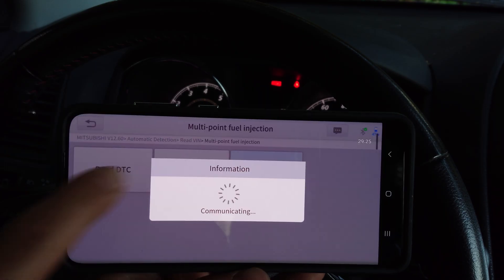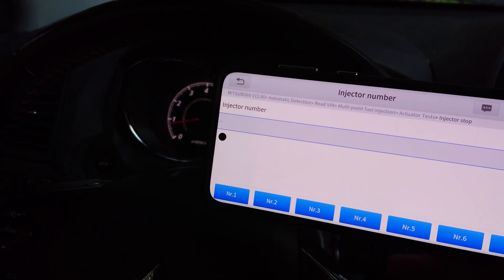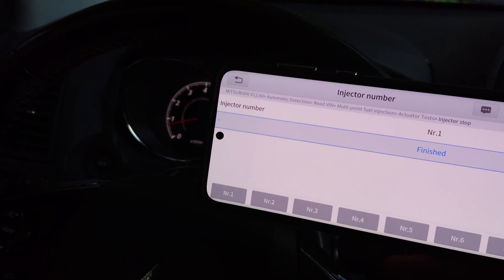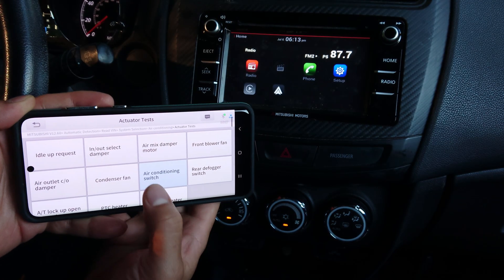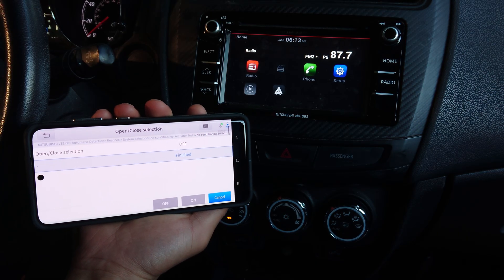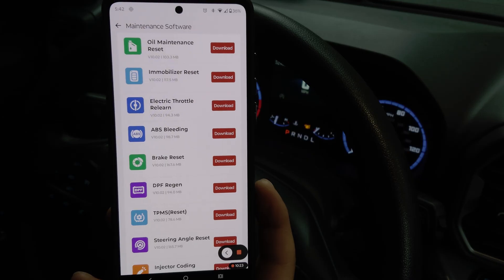Now testing the A30M's bi-directional control, we're going to do another actuator test — in this case we're actually going to try turning off one of our fuel injectors. You can see once I turn off one of the fuel injectors, the camera starts shaking, the RPMs start dropping, and we are indeed getting a successful test of an injector being turned off. Next we're going to take a look at the air conditioner control — trying to turn the AC on and off — and you can see that we can indeed see the LED turn on and turn off when testing it.